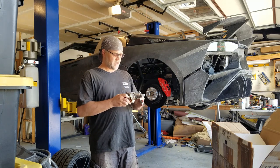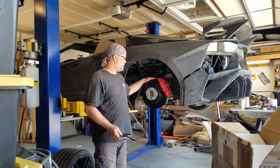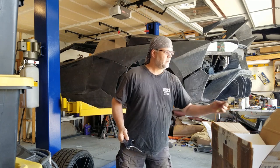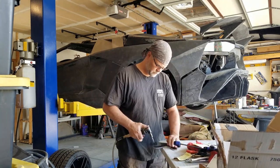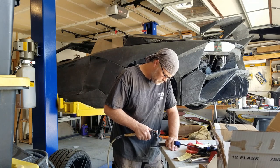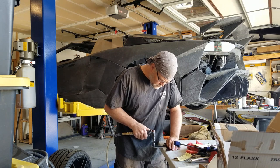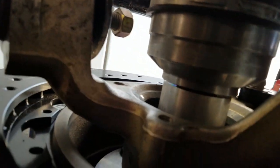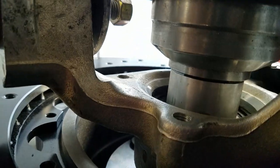There will be one of these parking brake calipers on each side. We have two extra holes in the spindle behind the rotor, and I've rough-cut a piece of material after making a paper template that has the hole locations for the parking brake bracket. Looking at the spindle, you can see the two holes we're going after — that's where we're going to mount the parking brake.